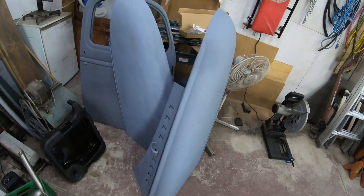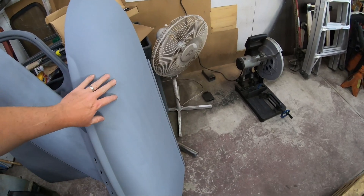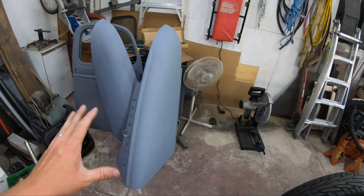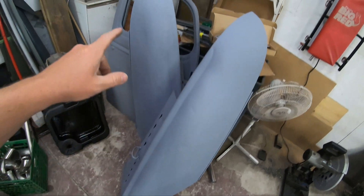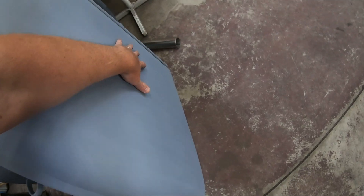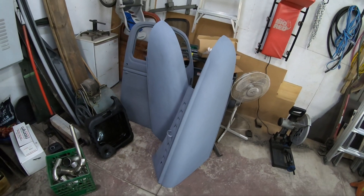I sent my hood off for blasting, got it all cleaned up, and got some primer sealer on there. Now you can see the dents - didn't actually know those dents were there before. No warpage though. I had First Step Blasting in Ontario do it - Al is the one who took care of all the media blasting, and zero warpage. Can't say that for the door - I had somebody else do the door and it is warped bad. But this hood, even being a big flat surface, he blasted both sides with no warpage. Very pleased with that.